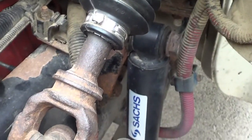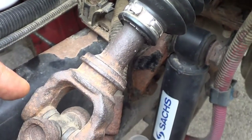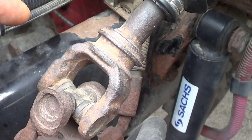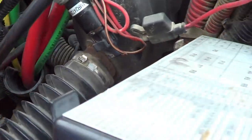I'm going to inspect my steering column. My steering column — I'm going to make sure there's no crack or broken, and it's securely mounted by two U-joints, one here and one on the top. The U-joints for my steering column — I'm going to make sure there's no crack or broken, they're securely mounted, no missing hardware. My steering column — if I pull on it, there should be no more than 10 degrees of play.